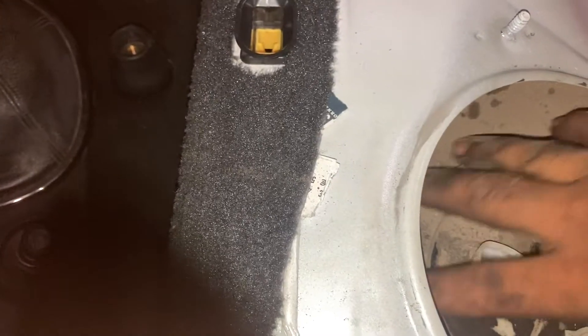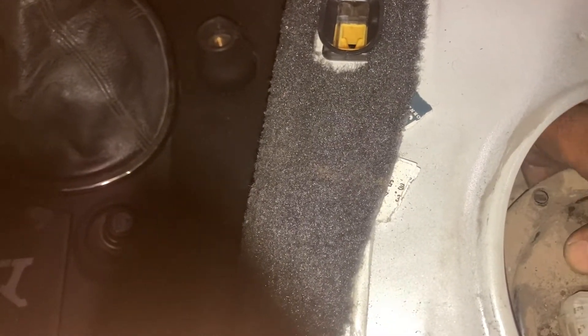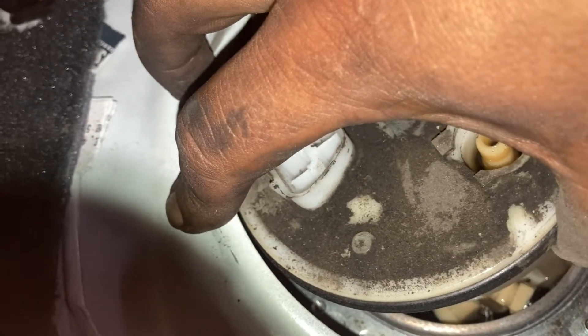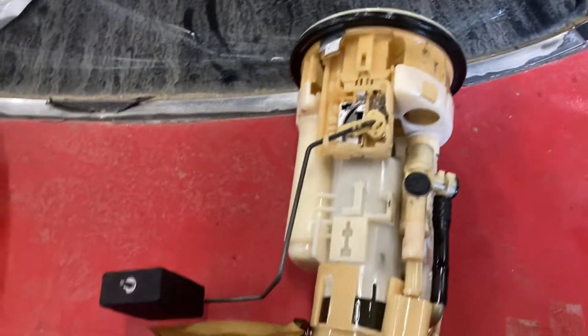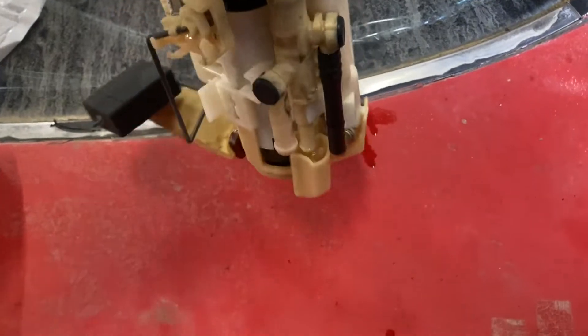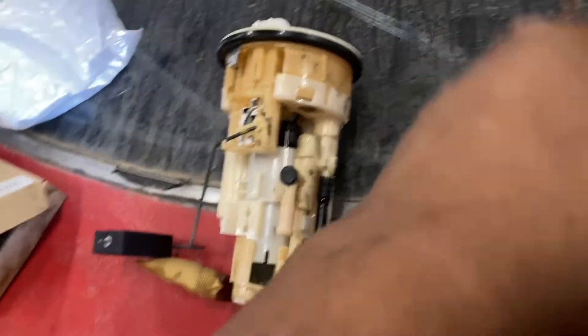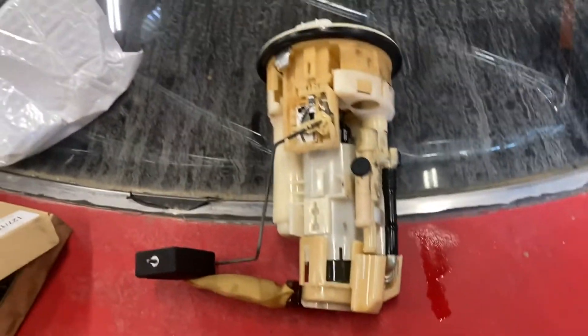So don't just follow me on this for your car. Once this top piece pops right off, it just kind of holds it in place and then you're able to get to the actual fuel pump. When you lift up on the fuel pump there is going to be a leveling unit back there and also a Venturi hookup in the tank. Here is your standard Lexus setup for all your GS300 and IS300 cars. This Venturi is set up to suction fuel from one side of the tank to the other since it's a saddle-style tank.